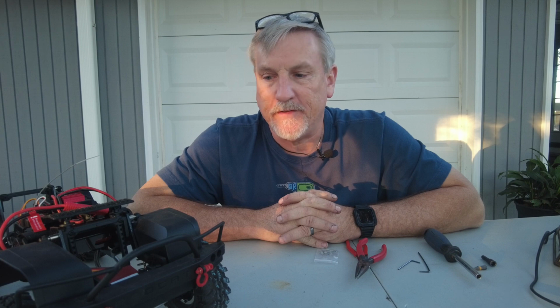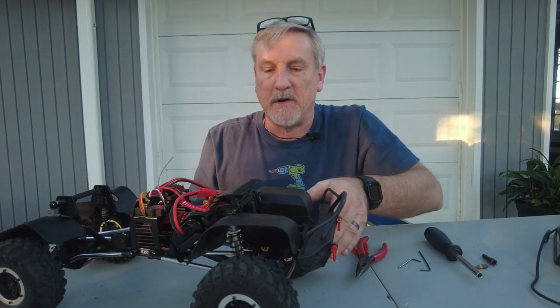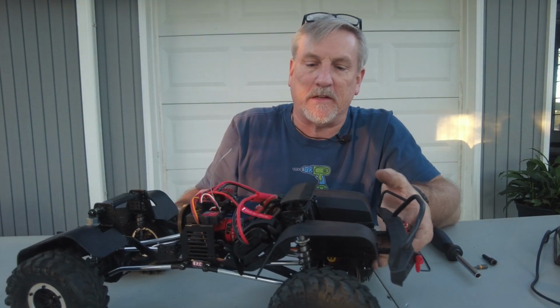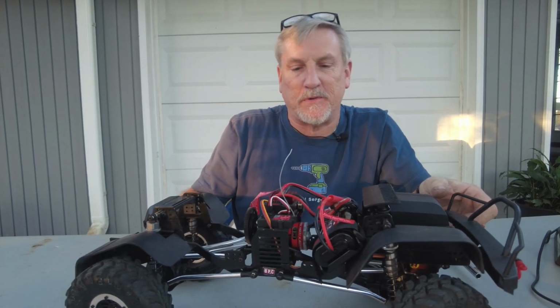The front wheels aren't fighting each other as much as they were, but it's not turning any sharper. But what's really weird is you saw it: 52.5 inches in reverse and 73.5 inches forward. Can you believe that? That's 20 inches different. That just shows you how much it's really pushing those front tires forward. Even though it's trying to turn, it's just the back tires pushing.